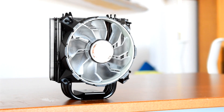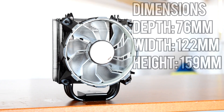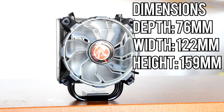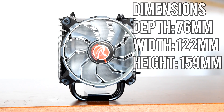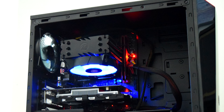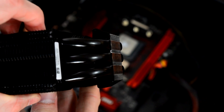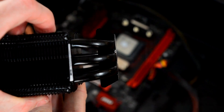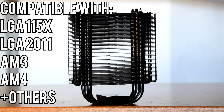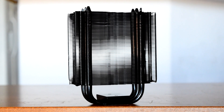At its core, the Lido is a totally black-coated slim 120mm CPU cooler, with the fan installed at 76mm deep, 122mm wide, and only 159mm tall. This allows it to fit into tighter micro ATX cases like the Masterbox Lite 3.1 from Cooler Master. The heatsink is a CPU direct contact design — the three heat pipes are right up against the processor. It's compatible with all modern sockets: LGA 1151, 2011, AM3, AM4, and the mounting brackets are included — no need to buy a separate kit.